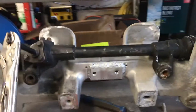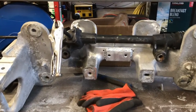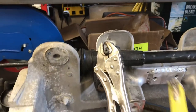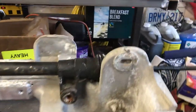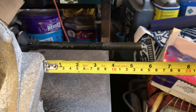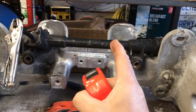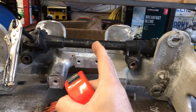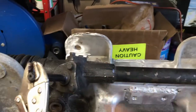So I took some measurements before I committed to making this bracket, because I had a feeling that this steering rack would not sit in the centre completely. I've centred the steering so that it's like two and a quarter, two and three quarters either way — that's the middle, so this would be your wheels straight. I've measured the distance between this and there and it's just under six inches; this side is just under five inches. So that means I can move the whole thing half an inch that way, which means this might actually line up with that hole. So I'll give that a shot — and then I only have to make a bracket for that side.